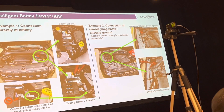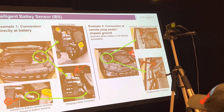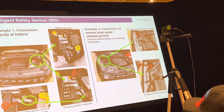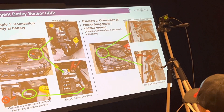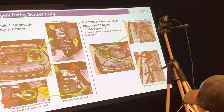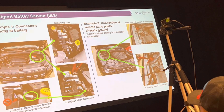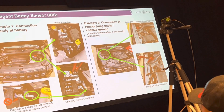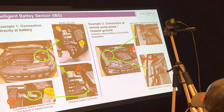Another trick: if you want to avoid losing all your stop-start data, unplug the IBS. If you unplug the electrical connector here, it knows that it's unplugged and it will resume right back where it was. So the other way around it is to disconnect here — then it won't have to totally relearn. It's when you blind charge it by putting the charger there that it causes problems.